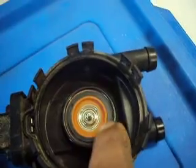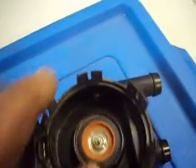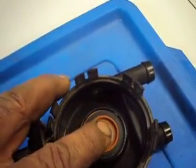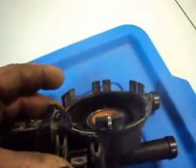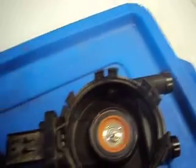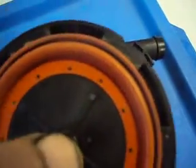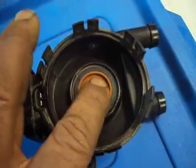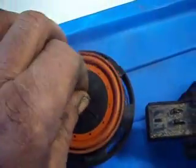The other part is the solenoid assembly. When the solenoid is not energized, the relief valve here is closed so there is vacuum in the system. When the solenoid is activated, that pushes the plunger down and allows the air to move through here. The purpose of that is for a check system, because once you start your vehicle up there will be vacuum in the tank — you often notice this when you take your gas cap off and hear a sucking sound. So when you start your car, the PCM will open the solenoid, which will release the vacuum, and then the micro switch will switch to the off position in the diaphragm as the pressure from behind is released.